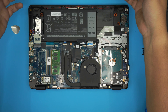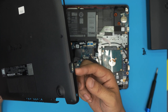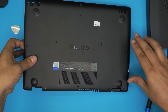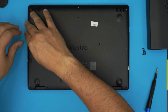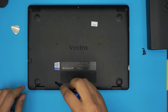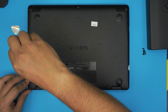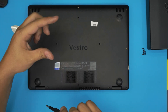Once the RAM is installed, grab the bottom cover and bring it in at a 45-degree angle, scooping the VGA side edge underneath the port first. Then press the corners, work your way along the front to the other corner, and then bring in the back side — make sure you hear all the clicks. First tighten up the c-lock screws, then put the rest of the screws back in their places. If you see any gap between the top and bottom cover, just pinch them together.